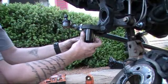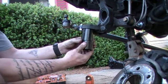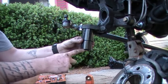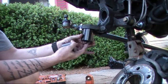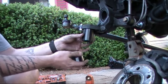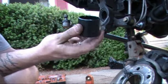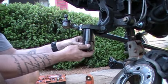First part, take this, slide it onto there. Next part, take this, put it onto there. The reason why you're doing this is so that the bottom shaft — the actual spindle part of the ball joint — has a place to pop out. It doesn't even need to be this long; you could actually use another chain of pipe if you wanted to. That goes there.